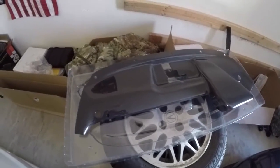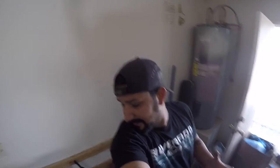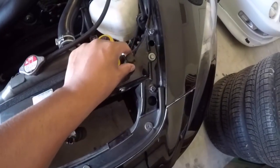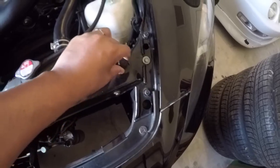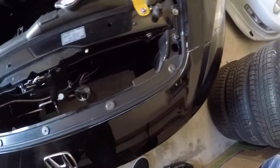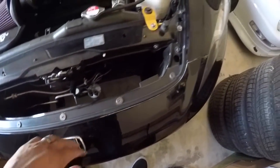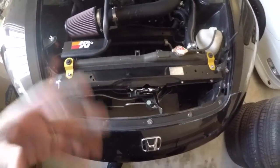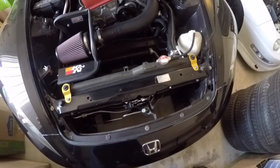So with that being said, let's get to the install. This product doesn't actually come with instructions, at least none that I found with their shipping stuff. But it doesn't seem to be a very difficult install. The way it looks, it looks like the only thing you'll have to take off is the radiator stays, this rubber piece — I already took this one off and that one — and then, of course, the bumper bolts or nuts or whatever you want to call them. And then after that, it should just bolt right in. So let's go ahead and give it a try.